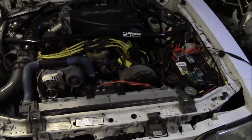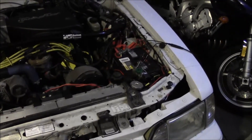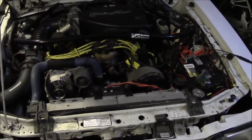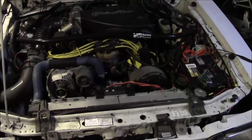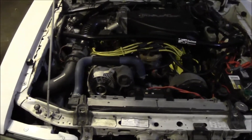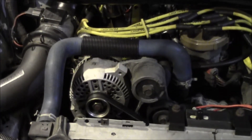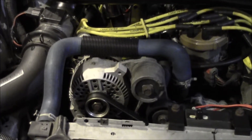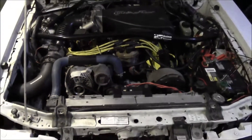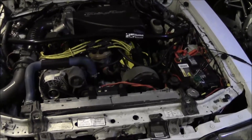If your car has been jump started, that battery really needs to be recharged by a battery charger. Even if you did take that trip for an hour at 65 miles an hour, you're putting a huge amount of strain on the alternator. It's operating at a hundred percent — it was not designed to do that. It's designed to recoup the charge in that battery, not run at a hundred percent all the time.